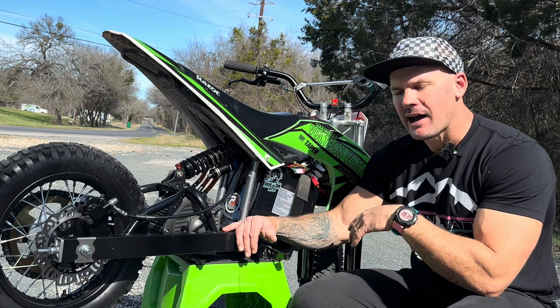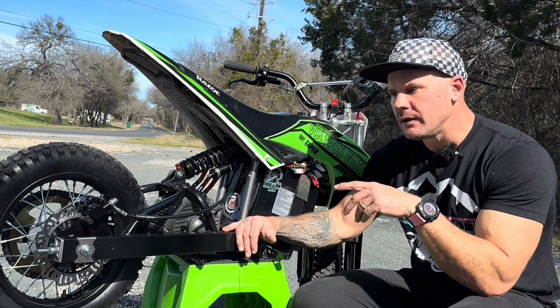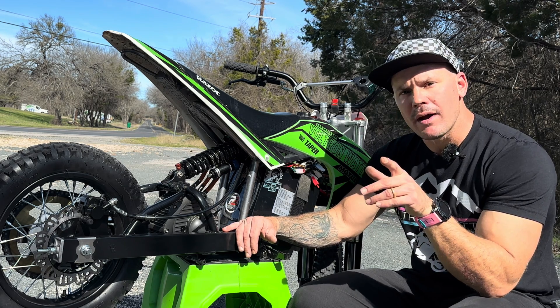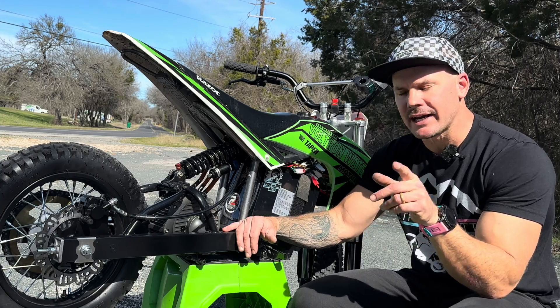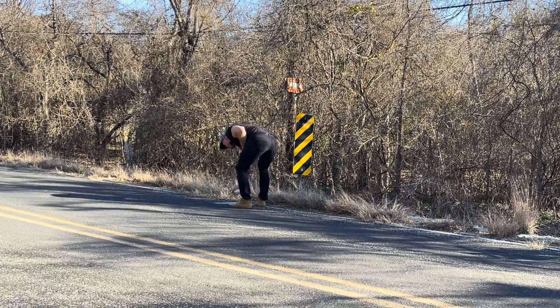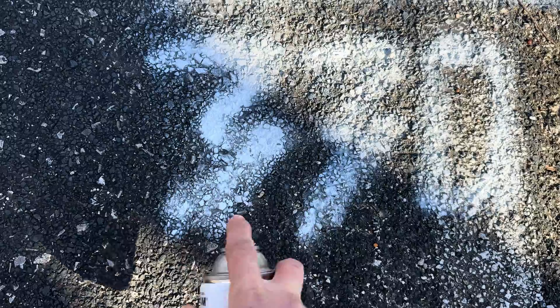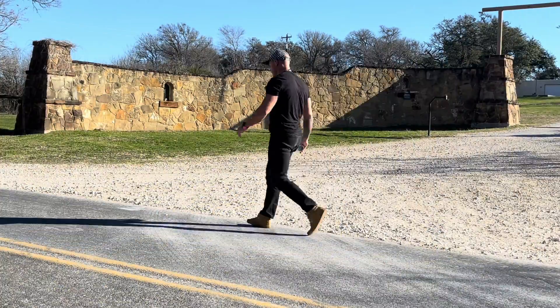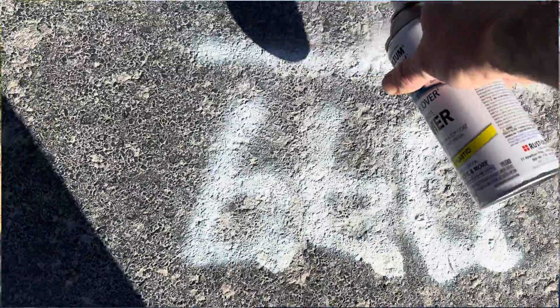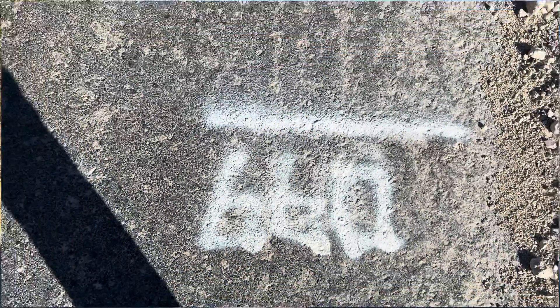I'm not pre-gaming any of this — haven't recorded it yet, so you'll find out as I find out. I've got a Draggy-approved strip behind me. I walked out 330 feet from the start and made a mark, then walked another 330 feet to mark 660 feet — that's the eighth mile. Those are the two times I'm looking to capture on the Draggy.